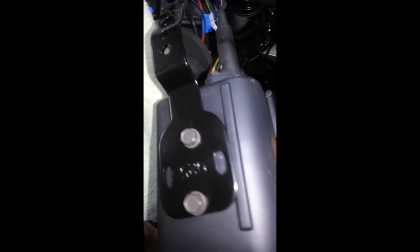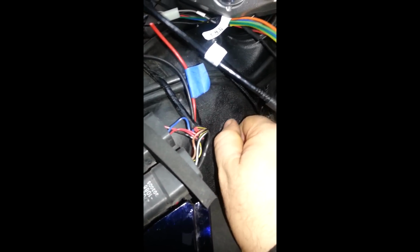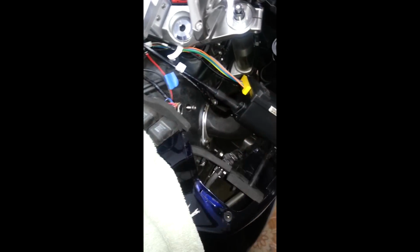Okay, so I think I got an idea on how I'm going to mount this. I took the stock mount and bolted it, and then I bent it in a vise a little bit and pounded on it, made it just a gentle slope like that. It's going to fit down in here, and there's a bolt hole there on the motorcycle I bought to use. Sorry, I don't know the size, but I believe it's the same thread size as one of these bolts right here in the side, maybe an 8mm or something, but this is just something I had laying in my junk drawer. So I think I'm going to screw it down to that. Now I'm just going to go ahead and screw it down, and I'm not going to remove it, because once I get it set, I think I'm going to leave it there. And then I'm going to try to test fit this and put this back on.